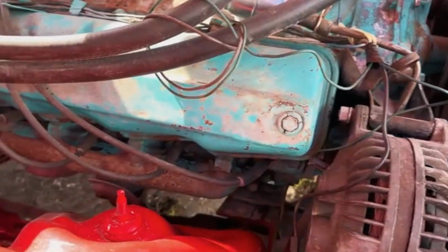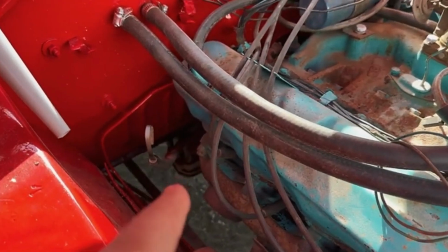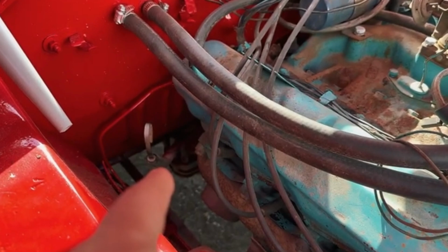So moving back from the radiator, now we're gonna dip the transmission and see how much fluid is in it, and I guess start putting some ATF in there. And in a moment of genius, I remembered dipping it while it's cold and has just sat is not the way to do it. You gotta let it come up to temperature, and I believe have it in park, all that jazz, and dip it while it's idling. So I went to start the car, and the battery was not cranking as strong as I'd like, so I got it on a charger.